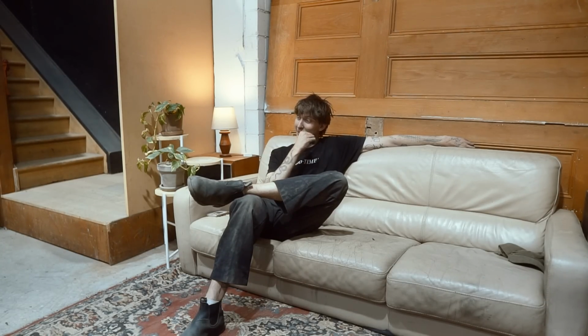I'm gonna have to be thrown in the deep end on a few of these things, especially stuff like these complex rust repair spots. But yeah, I'm doing my best, and we're seeing how we go, and every time I work on it, it feels like it looks more and more like a real car, and that's got me super excited. I did actually cut the front springs a little lower, so it's sitting a little flatter than it was before. So even in the workshop here, it's starting to look a little bit more cool and slick.